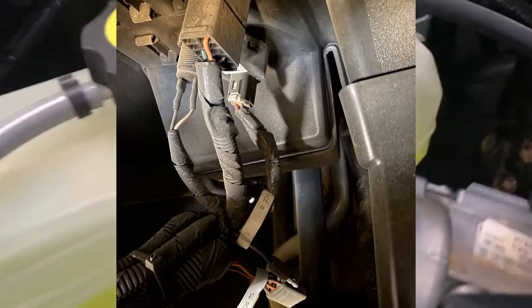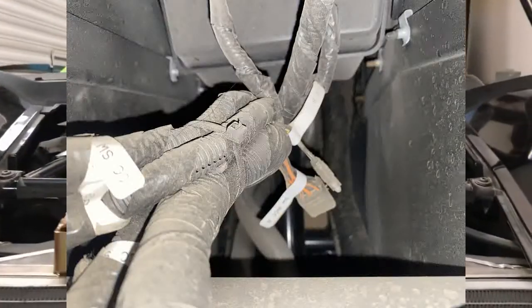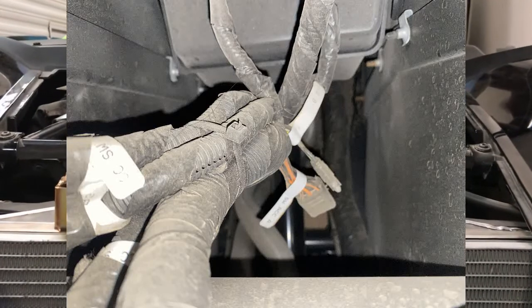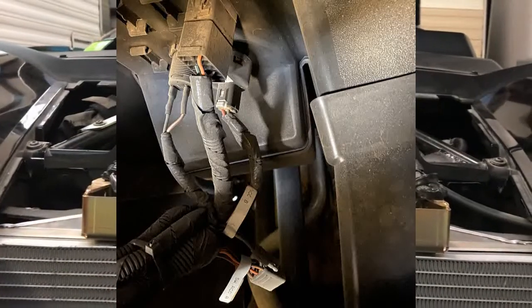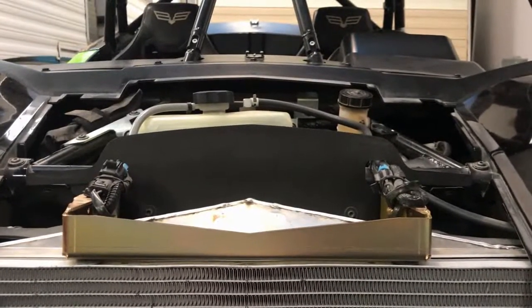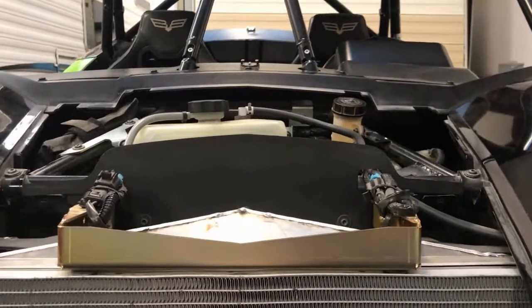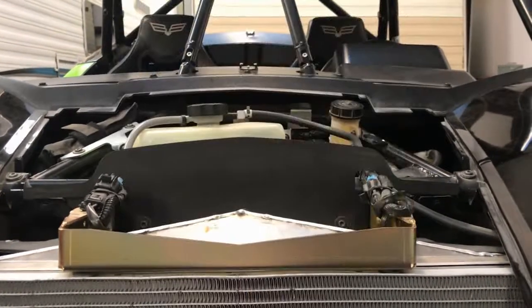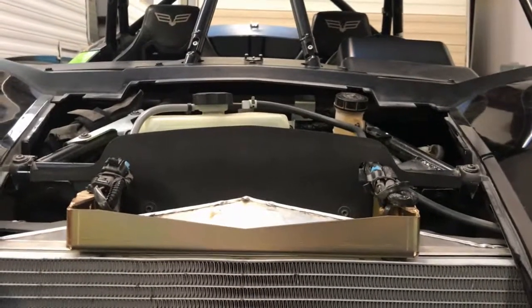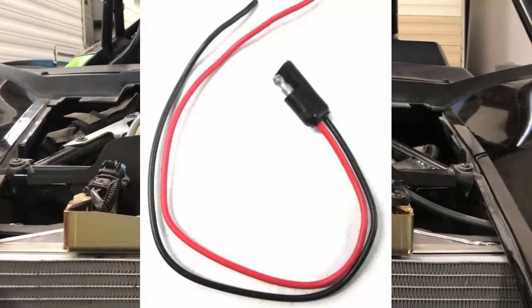The switched A circuit is the block that you'll see right down in that hole. I'll put a better picture of it in there, but the A power is switched anytime that the key is on, and there's a relay with a 30 amp fuse, and that feeds the A block, which is the 3 parallel SAE plugs. So you'll see 3 males, that's the 3 grounds, and 3 females right next to it. So you can take a standard SAE plug like I'll put in this video and plug into any one of those to get power and ground.